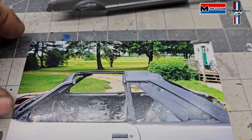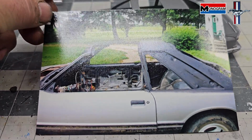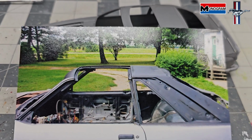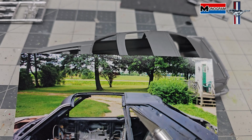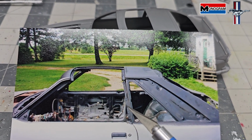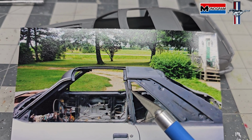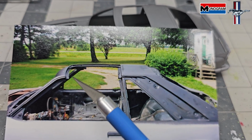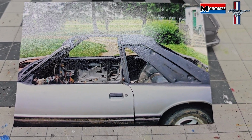So this is my T-top car that I have. You can see, like I was saying, how far that roof line comes back right here, and that other piece that's here has to get cut off because this is where the molding would sit for your rubber weather strip for the window when the window shuts. And then we'll have to build this frame in here, the T-frame for the roof. So that's what I'm going to do.